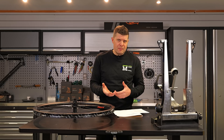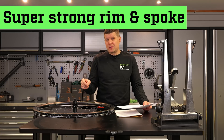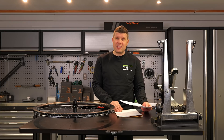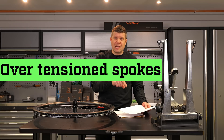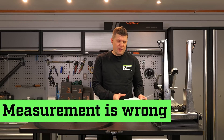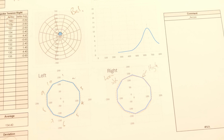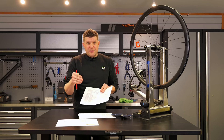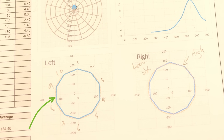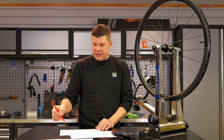With a deflection reading you don't have the problem of where to measure, because as you put it on it bends away from the interlaced spoke so you can take the deflection on the whole length. When you look at the numbers, they don't quite add up — either there's a super strong rim and spoke I'm unaware of, because building up to 140 kilograms of force is really really high tension, or the wheel maker has over-tensioned the spokes to the point where they're potentially quite dangerous, or the measurement is wrong. More context on that would be super useful. The wheel balancing diagram and the left and right spoke tension visualization show where differences in spoke tension are, and here there's a bit of a gap to where the averages are.